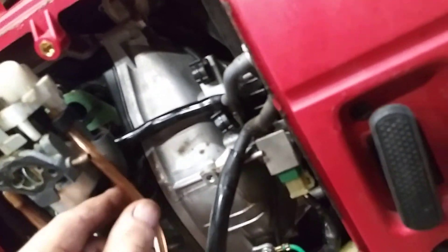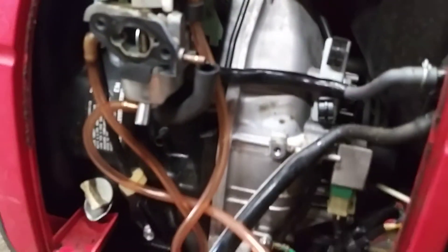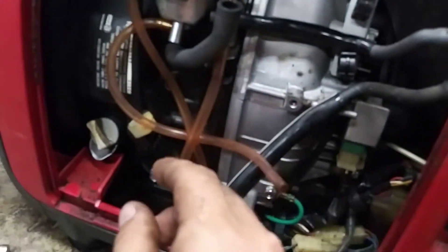Make sure this gasket's on the very back and slide this on. There'll be a new gasket in the kit in the description. If yours tears but doesn't come crumbling apart, you can always use Indian Head — it's just aircraft sealant. Wipe it on and it'll seal it right down tight. In a pinch it works perfectly.